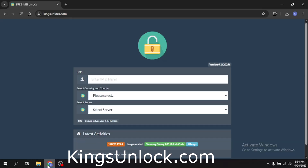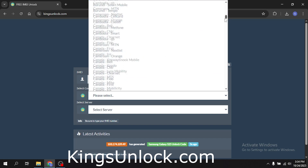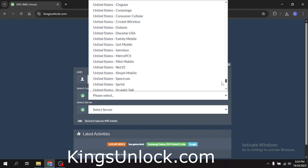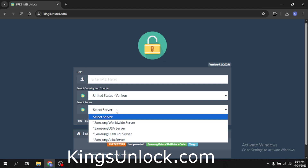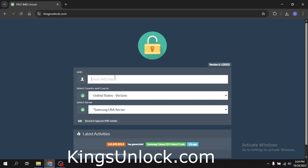Step two: we're going to go to the following website. Using this tool we will unlock the phone. We're going to start by selecting the original carrier and the country that your phone is currently locked to. In some cases you will get multiple services — some are faster than others. Next, insert your IMEI number; this is the number that we got previously.